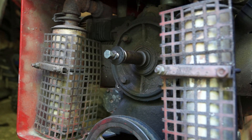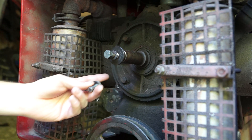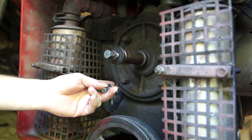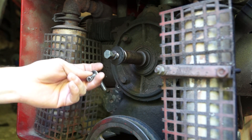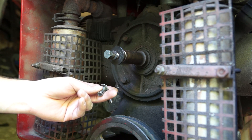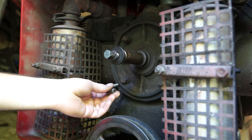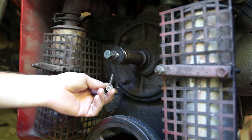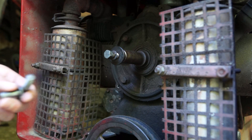It's week two on the wheel horse and we have some parts. I ordered a whole new plate for the front, but I'm going to try not to have to pull this off because then I'd need to order the shims that go behind it. This sets the back spacing on the crank by the number of shims. So what I'm going to attempt is to drill and tap this so I don't have to pull the plate off.